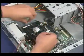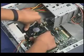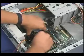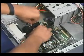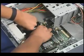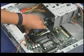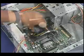With the clip levers in the upward position, push down on the 4 clip frame corners to secure the clip assembly to the retention mechanism. Close the clip levers in opposing directions, one at a time, to fasten the heatsink to the RM. The clip levers will require force to be completely closed. Lastly, verify that the heatsink is retained and that the clip frame is properly engaged with the RM.